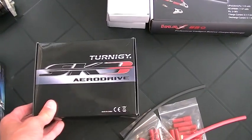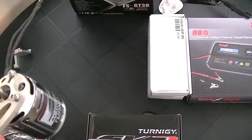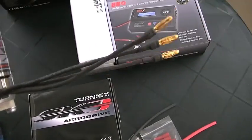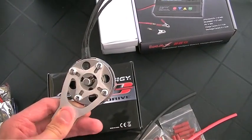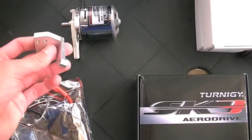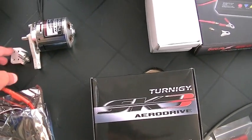First off, the motor needed to mount into the truck. That's the Turnigy SK-3 213kV. Fitted to that is a motor mount, which is waterjet machined out of aluminium, and this is what actually fits onto the truck.